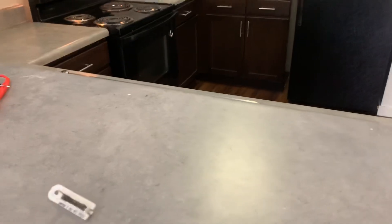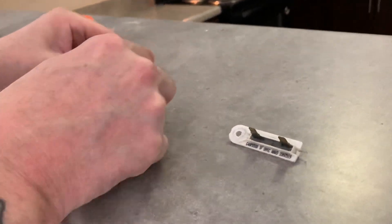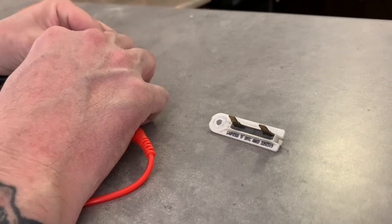Come to find out — I'll show you real quick over here, follow me. This one's her actual dryer. Right down here is where the thermal fuse goes, which I have over here so I can show you. I put my meter to ohms with sound — nothing. Dead.